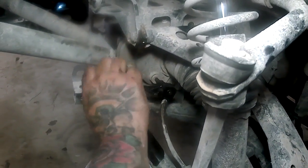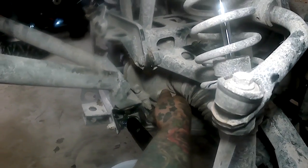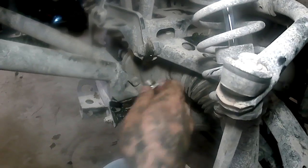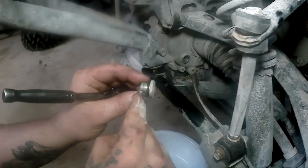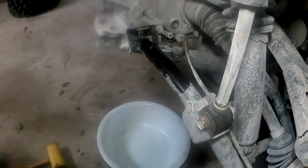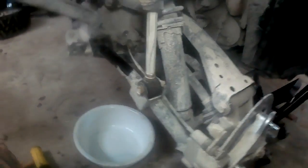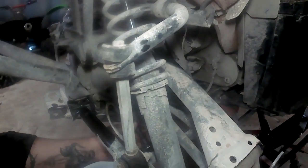Just give it a little love tap with a plastic hammer. I like to take the vent out first — gives you an idea whether your differential is full of water or not. Let's hope for no water. And nothing — we're good. We've got to make sure that this O-ring here comes out on the drain plug and that it doesn't get stuck in the housing. And we've got an extension on. Put it back in here and we're good.